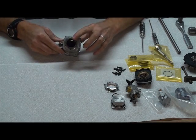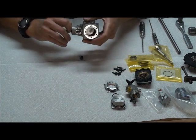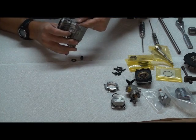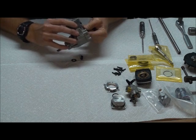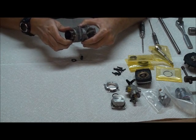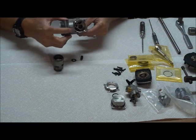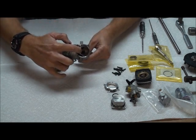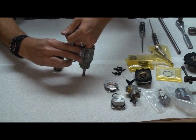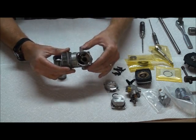Now that we've got the back plate and the head off the motor, I'm going to work on actually getting the piston and liner out of the motor. First, get the nut off the crank. Then, from the inside, put your finger on the inside, feel the bottom lip of the liner, and just push the liner out of the motor. Turn the crank so it's all the way at the top of the case, then pull up on the piston rod and it pops right out of the motor.